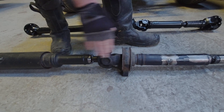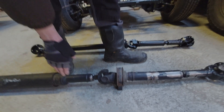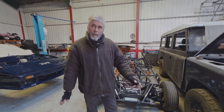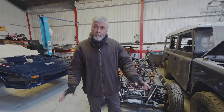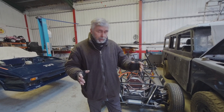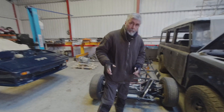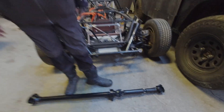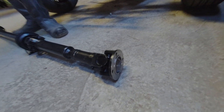If you have one long prop shaft it can start wobbling quite easily, so it's easier to use two separate prop shafts joined together for something running at high speed. For a low-speed truck you'd do it as a single piece, but for the speeds you're going to drive at, two-part is better so you can balance it. We make up a really rough prop shaft, check it all works, then send it to our supplier to make one like that using all new bits. And here it is — made by Bailey Morris, all new parts, fully balanced, completely new custom prop shaft.